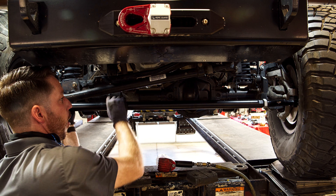If you have a Falcon EF steering stabilizer, like the one we removed at the beginning of this video, the provided clamp is also compatible with those. The bracket will need to be removed, so set it into a vise and heat up an area around the stud on the backside with a torch or a heat gun. This will loosen up the thread locker keeping it in place.